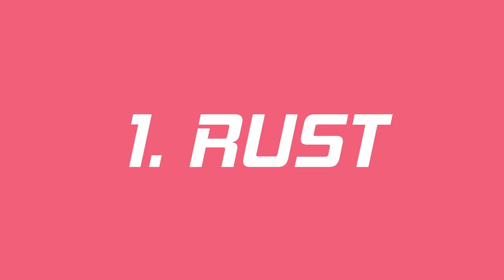So honestly, I think the first thing to look out for on these cars, and really any Honda of this generation and even some of the later years, is rust. This is definitely a non-starter for me. We do live in the South, so cars don't really rust here anyway. But we're talking about potentially 30-year-old cars here, so some of them may have lived their lives in the North, where they salt the roads, and this could be an issue.